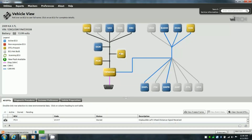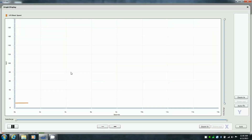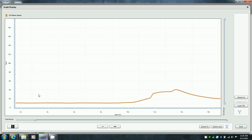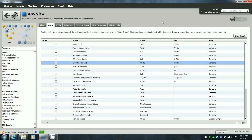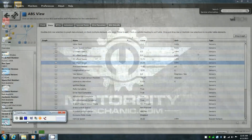At this point we've got the sensor replaced. We're pulling our data back up in the ABS module. Going to data — I've got it running in the air without a lot of speed, so right now the right rear isn't reading. Let's look at the left rear that we just replaced. As I give it a little throttle with it in gear off the ground, the rear axle starts spinning — and there you go, the left rear is starting to read. Both rears are now working. The fronts aren't reading because they're not spinning.